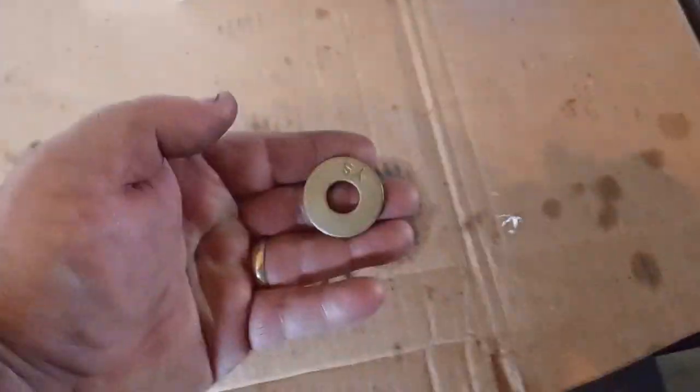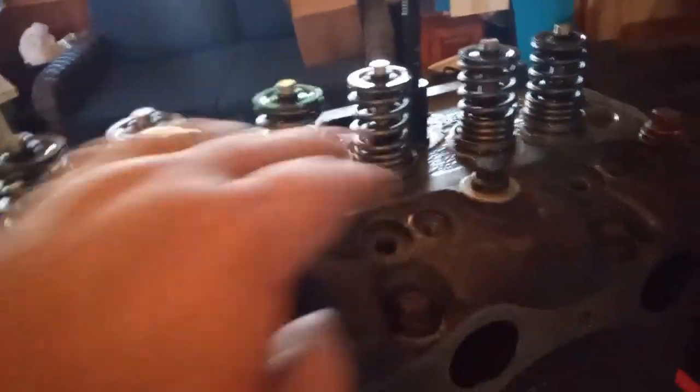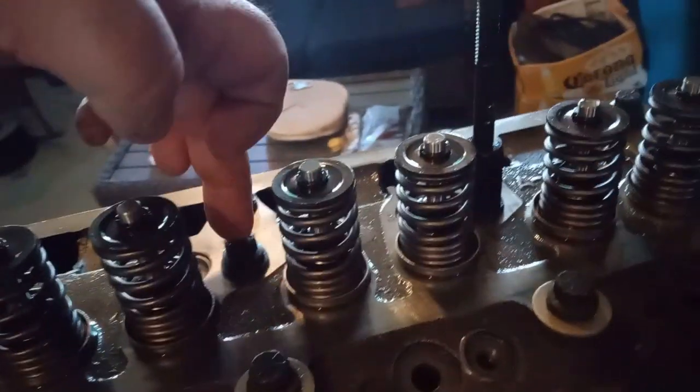The heads are bolted down. The washer debacle is over. It's kind of hard to find a washer that's small enough, but yet big enough to fit on the shaft of the bolt. So I ended up getting a little bit bigger washer, a grade 8 hardened washer. I swapped the three that were missing from here over to here, and put the larger washer there, there, and there. It doesn't interfere with anything here. I didn't want to put them here because the rocker towers sit there. So I figured that was the best place to put them anyway.